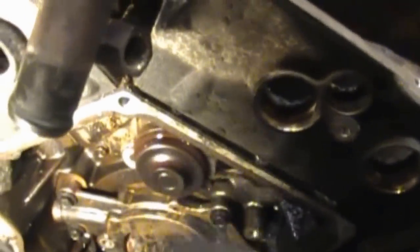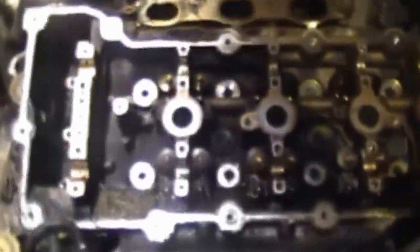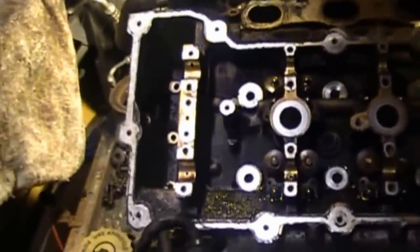I'm going to go ahead and just redo the whole thing because these water pumps fail and they get water in the engine and they just disintegrate the engine. They had a problem with these when they first came out, so they did an updated water pump. Once you get the new water pump on, this motor will run a long time if you take care of it. I know they get a bad reputation - the 2.7 apparently is the one that blows up - but these motors run just as good as any other motor if you keep the oil changed.